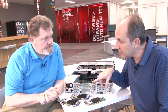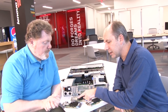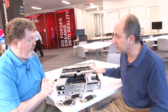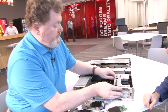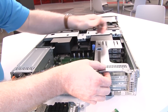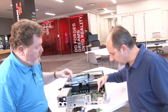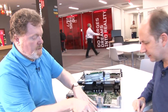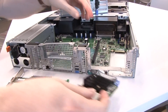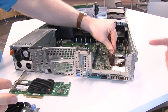There are some 16 gig and some advanced 8 gig adapters. These any-fabric adapter form factors go in servers like the RD 650. The RD 650 and the 550 have a new dedicated IO slot on the board itself. In the RD 650, you pull out this riser card, and here is the any-fabric connector. You pop the little plug-in that comes with it and install the adapter — it just slides right in with a little click.